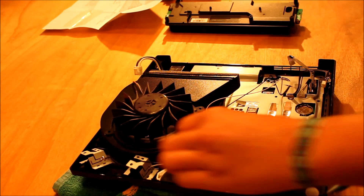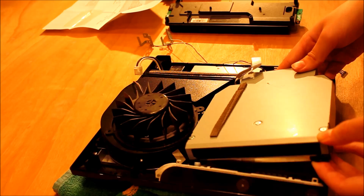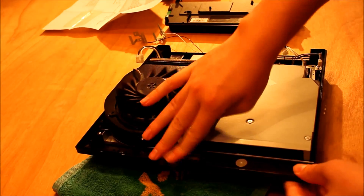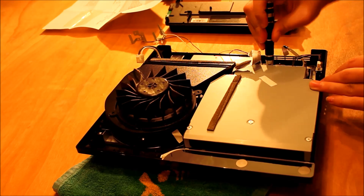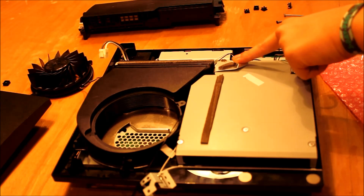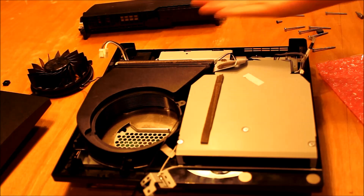It goes in this way — I don't want to catch any wires. I'm just going to move these to one side. When the drive goes in, it fits the front part; it has two little black parts that fit underneath there, so that goes down. This goes on top. You replace the black screw at the back of the drive — it fits onto the little black piece of plastic and attaches the drive to the PlayStation. After you've screwed down the black screw, you're going to lock this little piece in. It has the blue tab on the end and goes in the socket behind. To open the socket, the little black tab should be in the up position; to lock it, it should be down. So you push it in, flip it down, and that should be locked in.